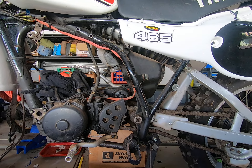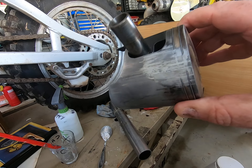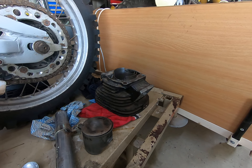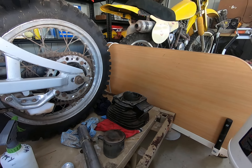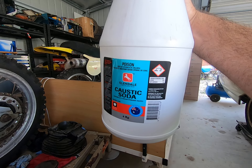In order to get this bike going again you need a new piston and you also need to do something about your cylinder. You could re-bore the cylinder and go an oversized piston — no problems there — but with these older bikes it's getting harder and harder to get oversized pistons. So what I'm going to do is make this cylinder work with the same size piston.